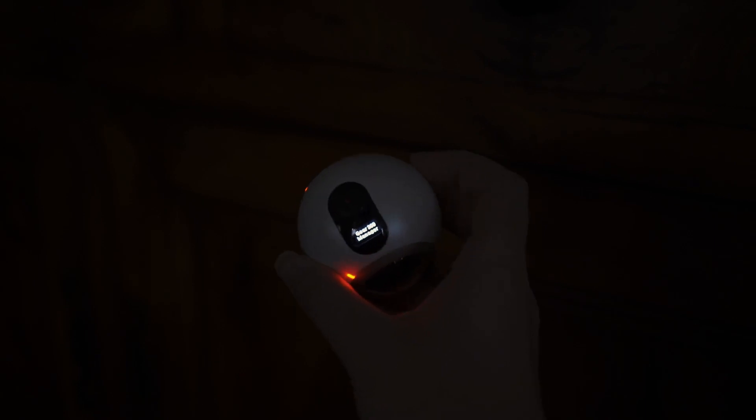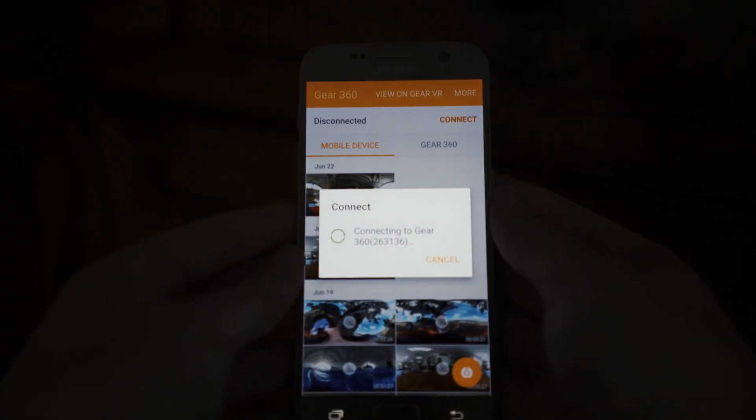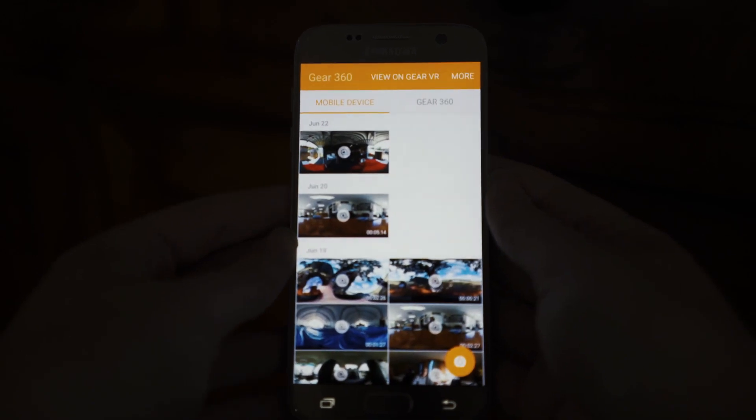So how do you get the video and pictures off the camera onto your phone, the Gear VR, or the internet? The next step is transferring to a Samsung phone — this is a Samsung Galaxy S7. Hold down the Bluetooth button on the camera and you'll have Gear 360 Manager pop up. Then on the phone, go to the Samsung Gear 360 app and click on that — that's how you connect the two together. Once you're at the Gear 360 Manager, click the record button and it'll say waiting to connect, then press connect on the camera. If you're having trouble, press more and select connect to new Gear 360, and make sure the number on the camera lines up with what you're connecting to on your phone.